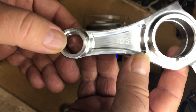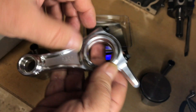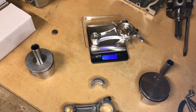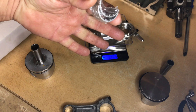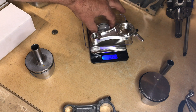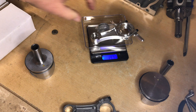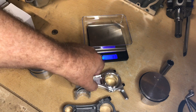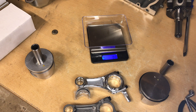And this is the 8281 — this is an EC forged billet rod. It's 3 inches, 353 thousandths — that's that long rod, and you guys know I like this long one. With the bearing added, it comes in at 147.1 grams. Now some guys don't weigh the bearing, but I think you've got to really count everything on the end of that crank throw, on that rod throw — it all adds up.